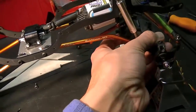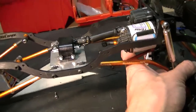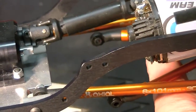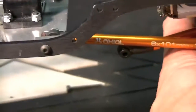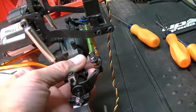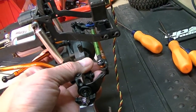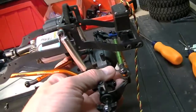Just rotate this up a bit. You can see right in there — I'll put another flat on and I will mount it to the lower links. I'm hoping that'll work out okay. And then to adjust my pinion angle, I'll just have to either put a nut and use that to adjust, or just put some washers and shims — that'll make this connection here a little longer or a little shorter as needed.